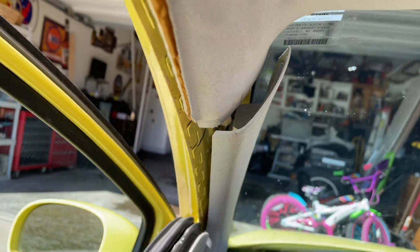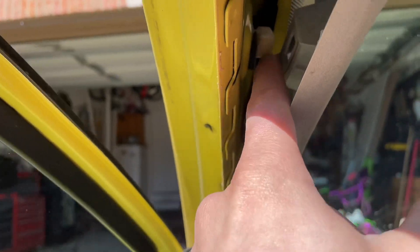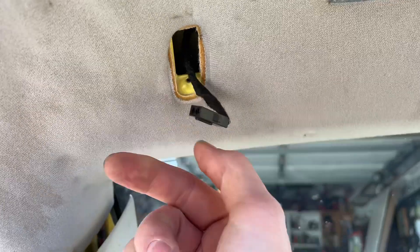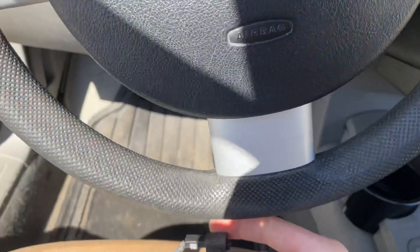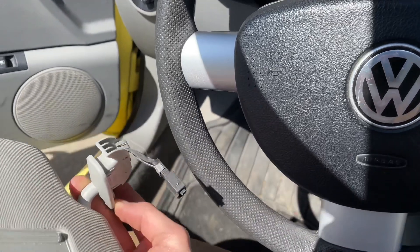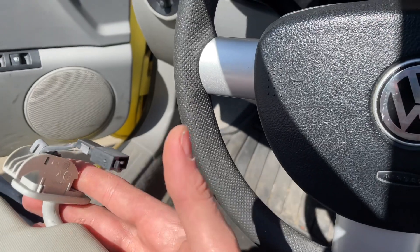For this part right here, you just pry it off — it's very simple. Once you pry this part off a little bit and you're already taking the weather stripping off, you can see the clip back here and it's very easy to just pop this bad boy off without damaging any clips. Once you pull that Phillips head screw out, you're gonna want to pull down this way and you'll have to fight with it until this wire feeds through because the whole connector is fed all the way up there. There's a little bit of wire before the connector.